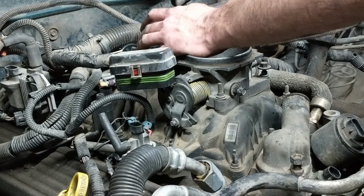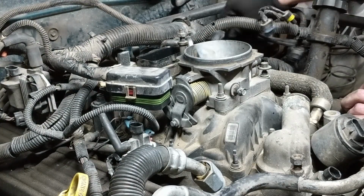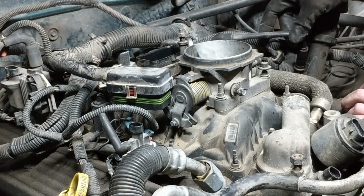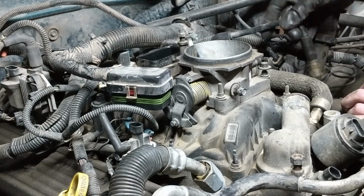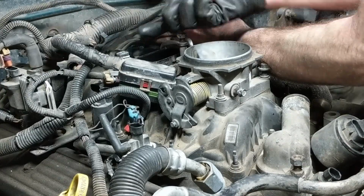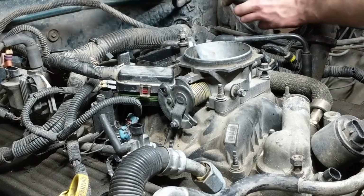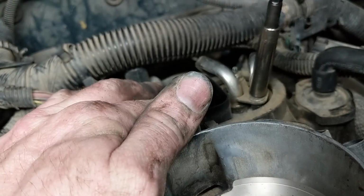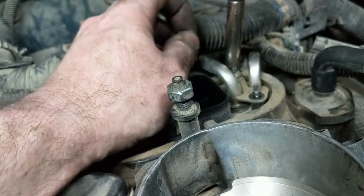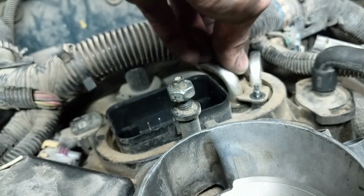Sometimes you can get away with a crack depending on how big it is or where it's at. But in my case, I wasn't that lucky, so I had to buy a used head, which was still rebuildable. I had them both machined and completely rebuilt, cleaned, with new valve seals and all that good stuff. My point is that if you're just doing head gaskets, you can't always see cracks and you can't always see imperfections.